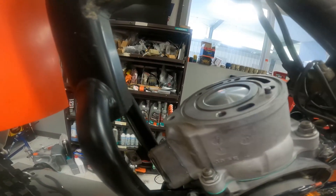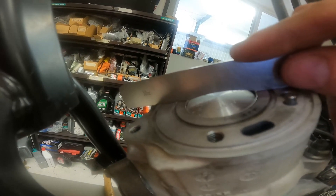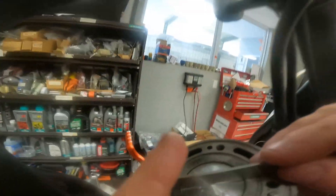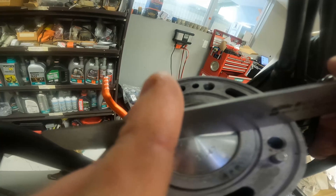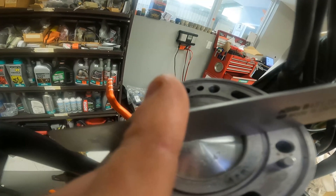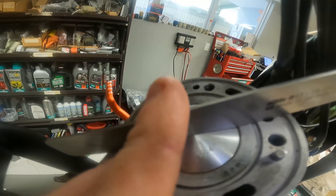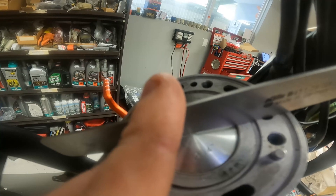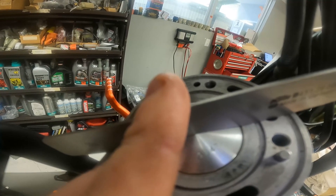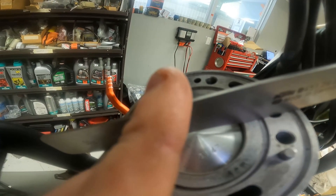What you will do is take one hand and hold the tool, and take the other hand and spin the piston up to where it comes up. Now it can touch this tool, but it can't lift it — and that's pretty much where we are right now. I can feel it touch but it doesn't lift the tool off the surface of the cylinder.